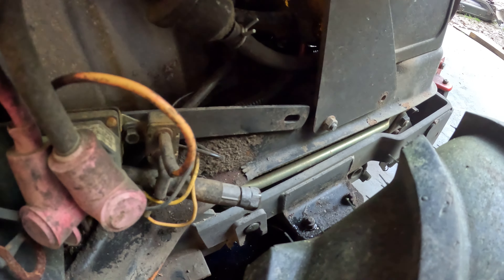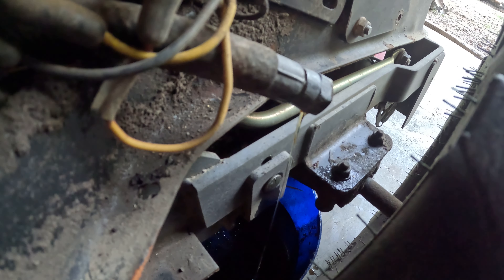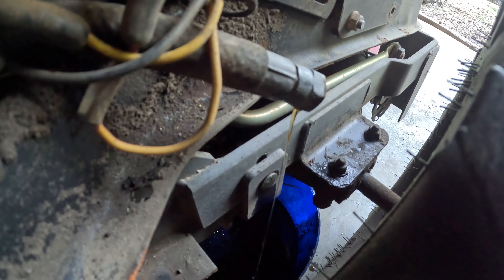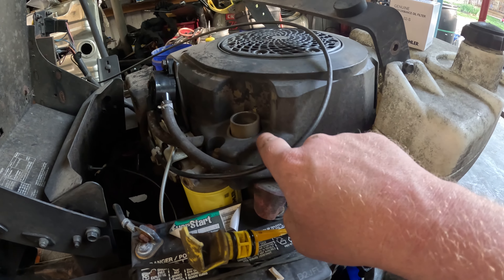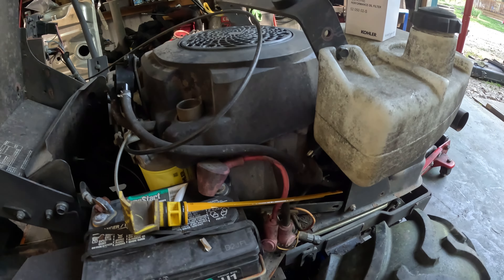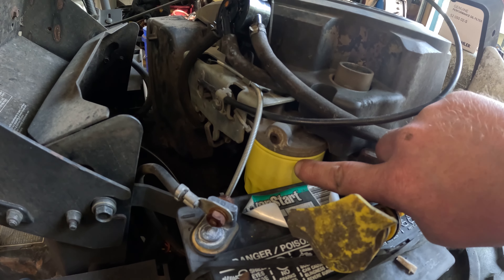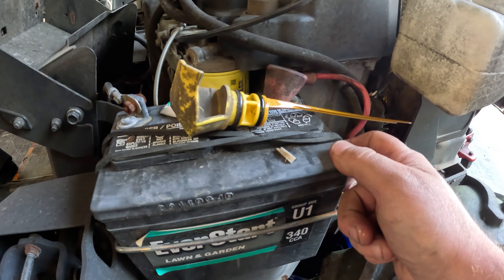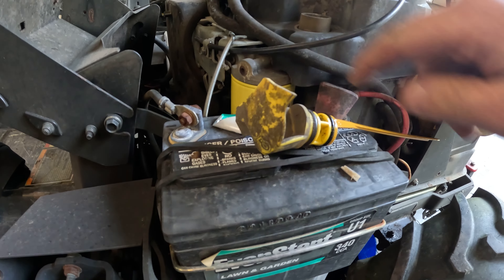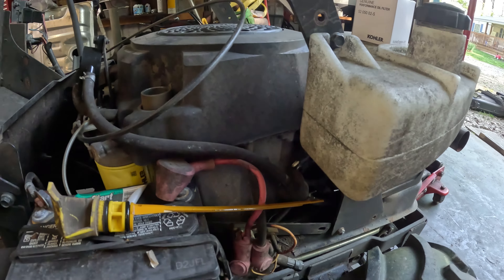I've got it inside. I've got the back end on the jack. I'm not getting under it — I'll have to use a little cutoff bucket for draining the engine oil. Usually I'll just hold the fitting on the drain hose with a pair of vice grips or a wrench. Take the plug out, then I'll let this jack back down and let the oil drain. I'm also going to be draining both rear axle assemblies and we'll service those out as well.